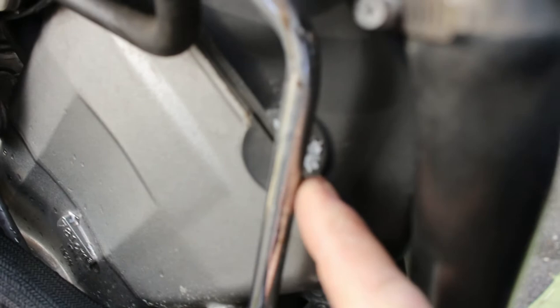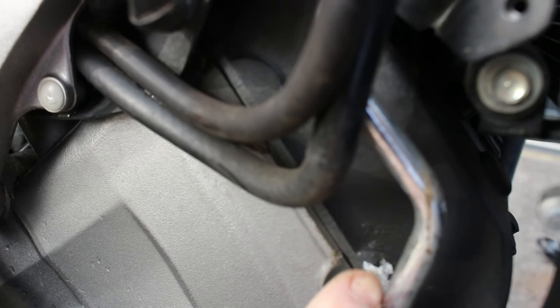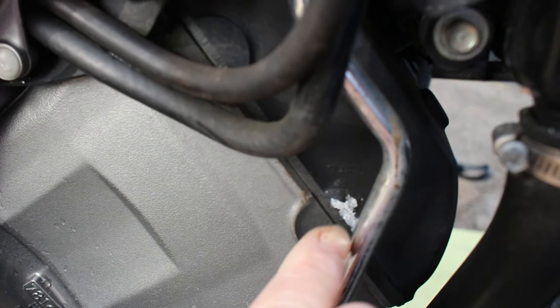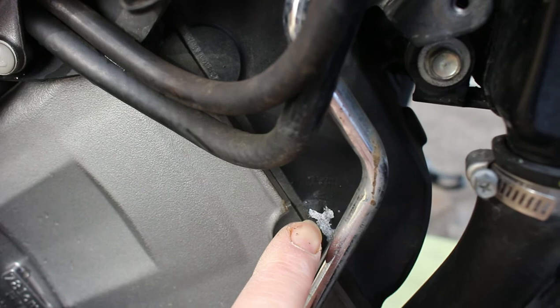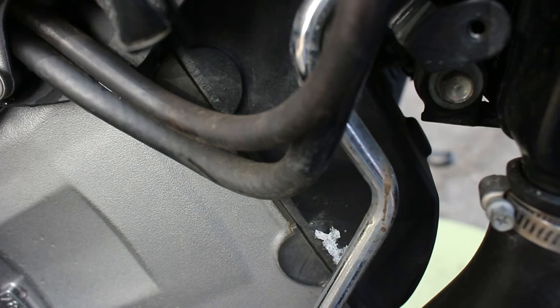Unfortunately whilst cleaning the bike on this area here, we have got a little bit of paint that's flaked off. All of the rest is good and we've already painted the front face here. So what I'm going to do is rub this little bit of flaky paint off, get in here with a brush and spray some paint into the cap, then just apply it with a brush to tidy that up and help protect it. As you can see, moisture has got underneath and blown the alloy of the cam cover - that's why you see that white powdery look - it expanded, blistered, and blew the paint off.